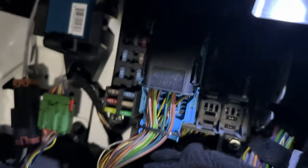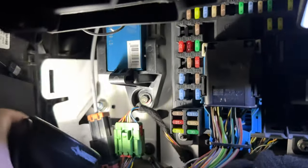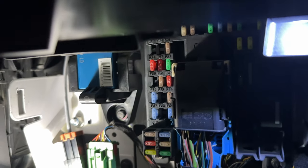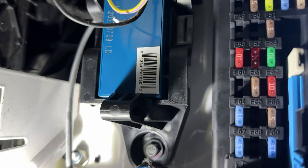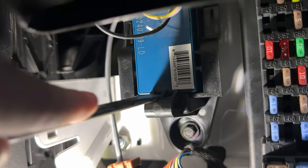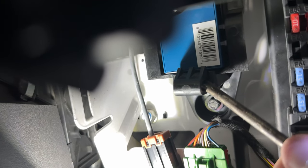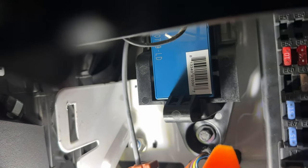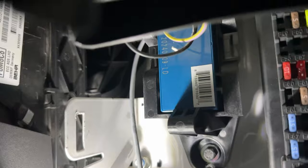It was much easier to push the battery back in. This clip was kind of hard to get off, but the way I was able to do it was I used two tools. I used a screwdriver in here — there's a tab you're supposed to push down, but it's so hard. I stuck the screwdriver in and pushed towards the battery, then used another tool to wiggle out the battery. As soon as I got the clip past the lip of the battery, I let go of my tools, grabbed the whole battery with my hand, and wiggled it out. Going back in, it went in immediately.